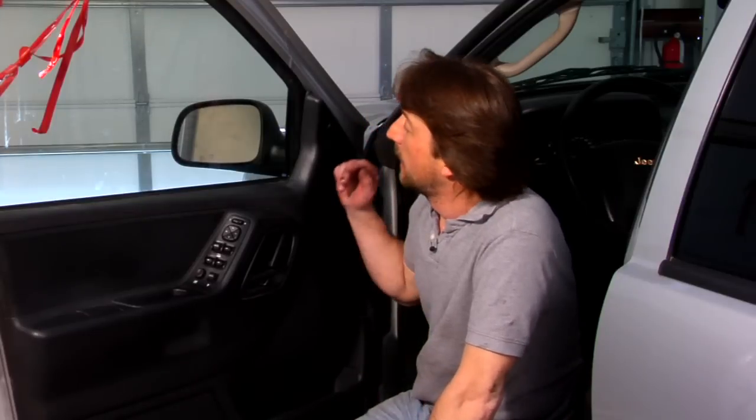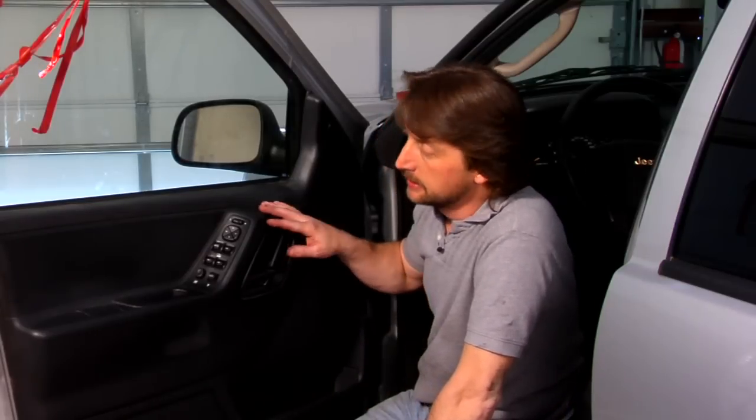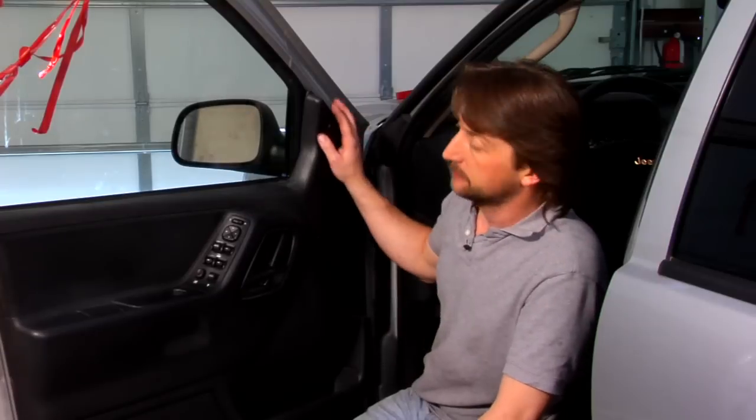Good afternoon. My name is Tom Brinsonoff, Certified Master Tech out of Reading, PA. Today I'm going to talk to you a little bit about how to replace your car door mirror. It's really not that difficult. The first thing you want to remember is you've got to take your door panel off. You've got to take all your screws off — this one has like five or six of them. Every vehicle is a little different as to the location and how the panel comes off, so if you're not sure, you might want to get yourself a repair manual and look at it first.